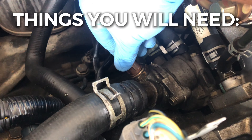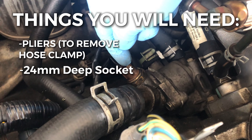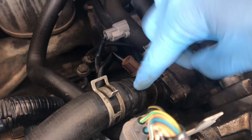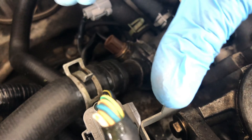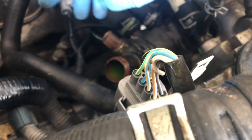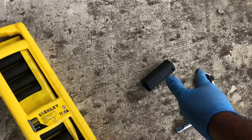To replace this you're going to need a pair of pliers and a 24mm socket. First things first — we already loosened up this hose clamp. You've got to remove it, put a drain pan underneath so you don't spill coolant, and make sure the engine is cold so you don't burn yourself. Once you remove that clamp, take this hose out of the way and you'll have enough space to get to the sensor back here.